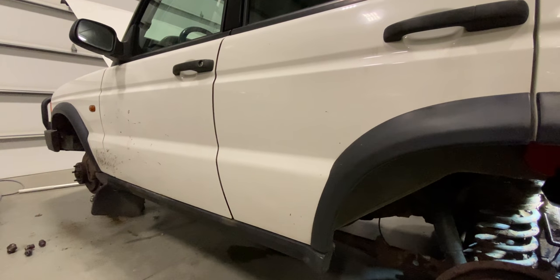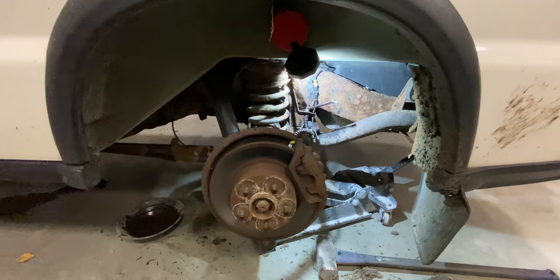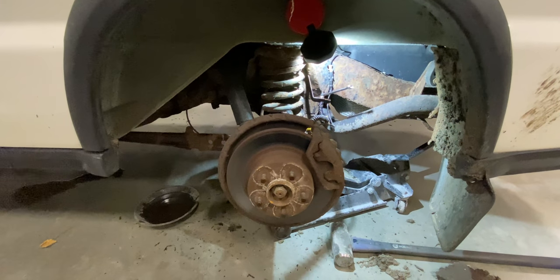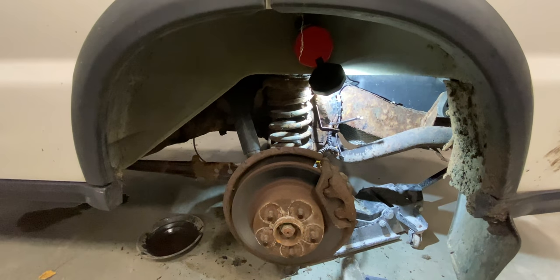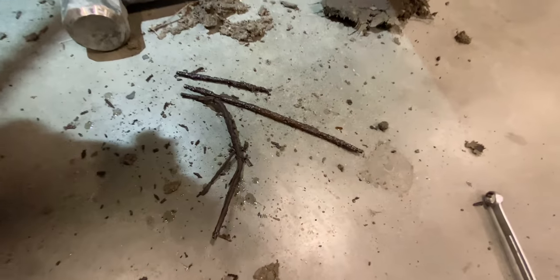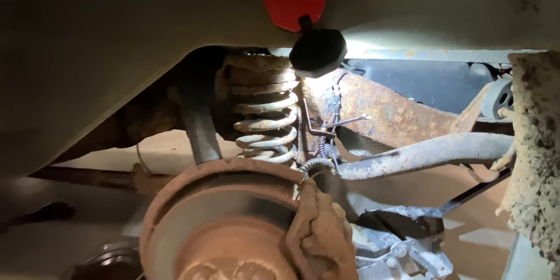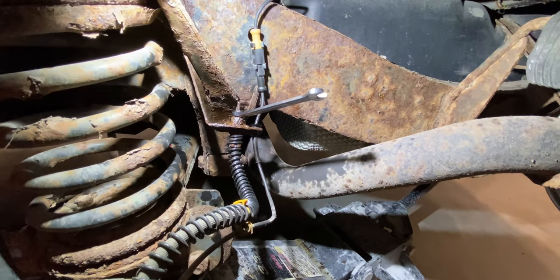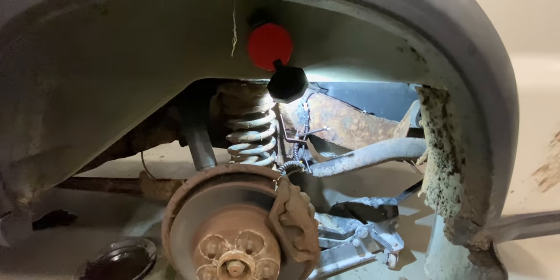I drove it home, and on my way home the brakes went completely out on me. I was pushing them pretty hard — I wanted to get all the brakes cleaned up. It looks like the brake line has just completely rusted and disintegrated. When I touched it, it just fell apart into pieces. I'm going to try to get it loose at the hose and install a new brake line up as far as needed to fix this.